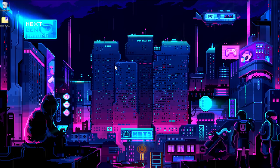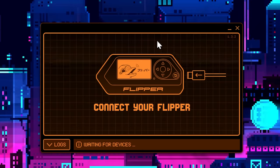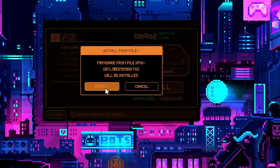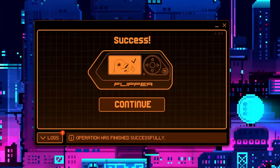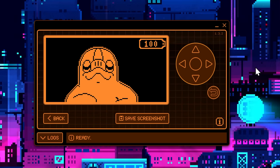Visit the site, save it to the desktop, and then we can install it via our normal update process. Now that we have our file, I'm going to plug my Flipper in and start up QFlipper. We'll go to install from file, then navigate to the desktop and install that, and click Install. This takes a minute but we've done this over and over again. Success — hit Continue, and you know you're on XFW once you've got this as your landing page.